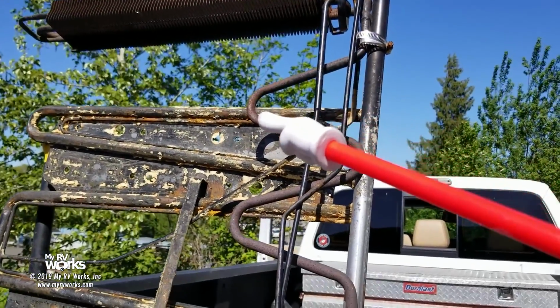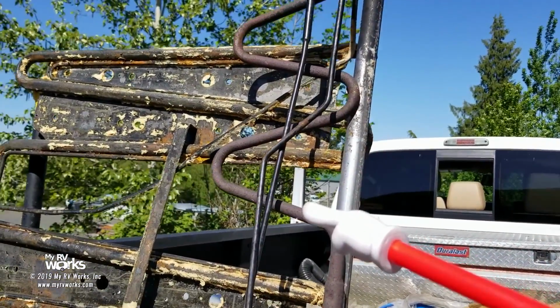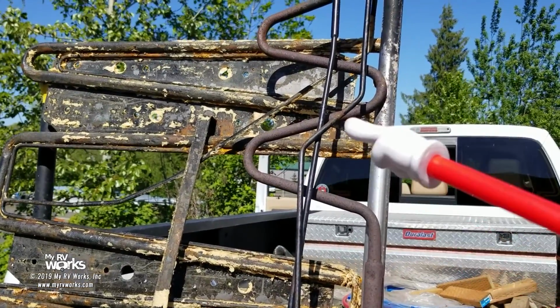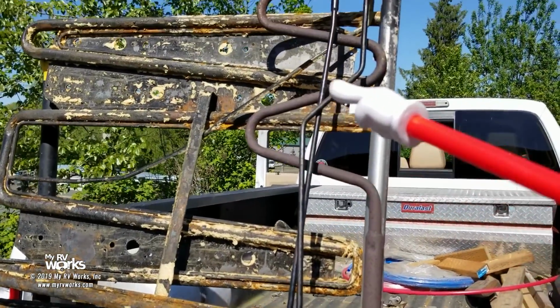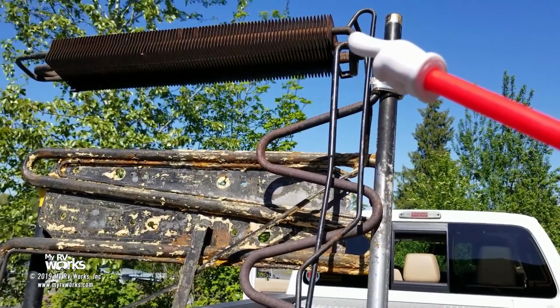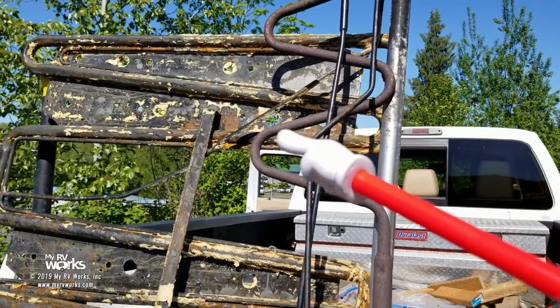But what we're doing in this surface area here is we're done with the water. The ammonia is going to stay as a vapor. The water is going to fall back down. Now let's leave our ammonia. So the ammonia is boiled out. You've got ammonia vapor right here following up this tube, okay? We're going to pick up the ammonia back up here on the top at the condenser, but let's follow that water. What happens to the water as it cools down?